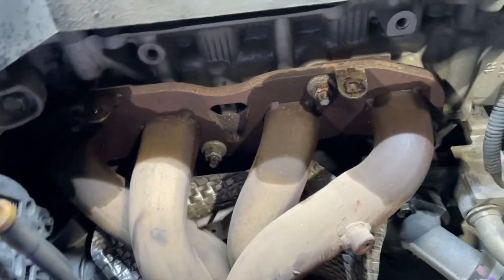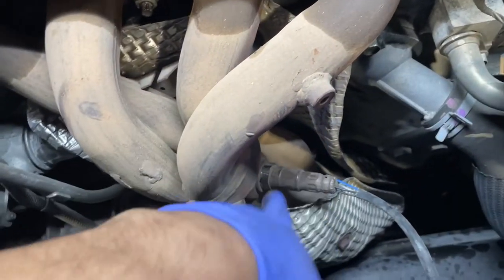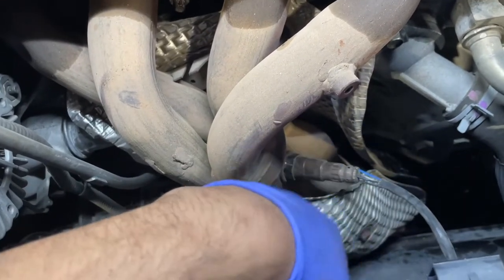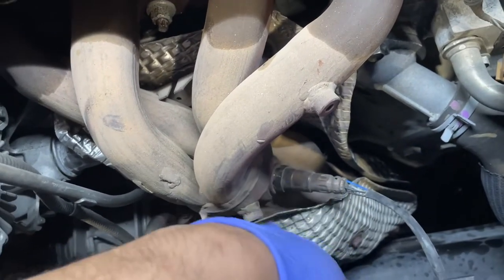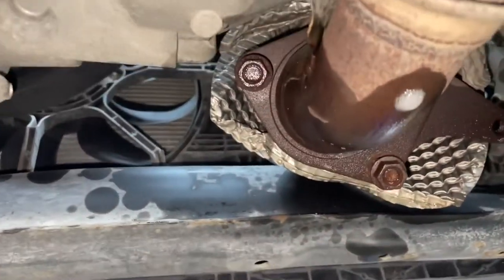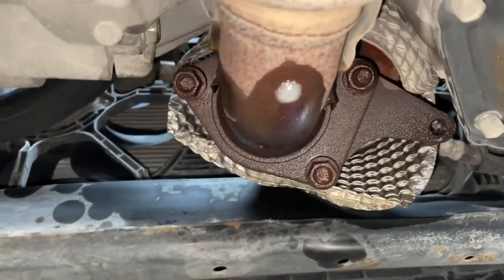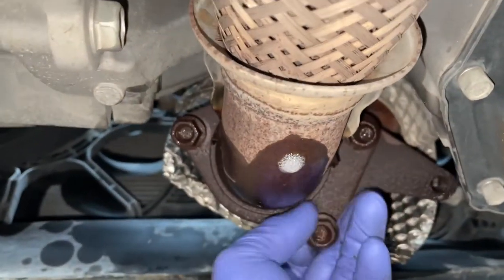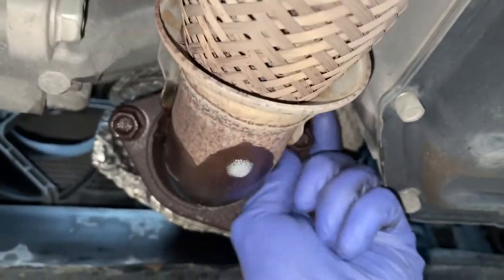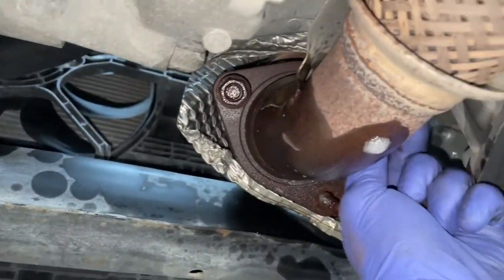So we can get that removed later, but we can do the bottom first. I'm having trouble removing the O2 sensor - I might have to take it out of the vehicle. I don't have much room because my O2 sensor socket is kind of stripping and I don't want that to happen. So now we're at the bottom - all we're going to do is remove three 15mm nuts. I've sprayed it with WD-40 to make life a little easier, then we'll go back up top and finish up.